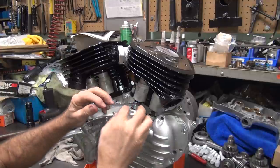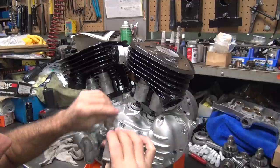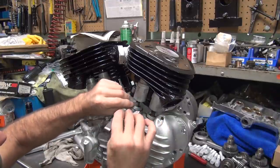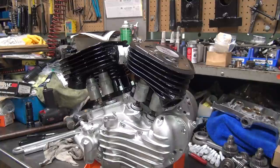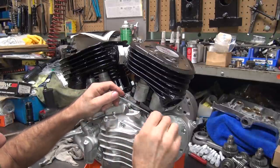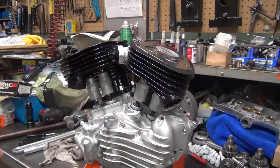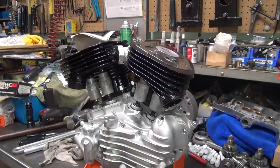The tight spot on this one is at about the 10 o'clock position toward the back side. There's a little bit of a burr on the end of this too, I think. That one works good. Over here we have a lot of room on this one, but on this one we have almost nothing for adjustment — if that goes down much more we're going to have a problem. Next time we do a motor, make sure you put the worn-out lifters on the intake, not on the exhaust side.